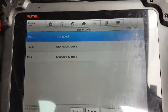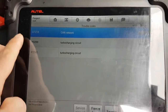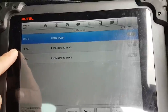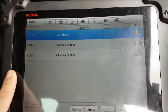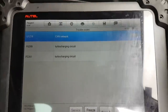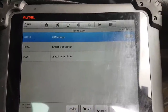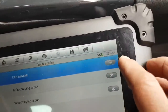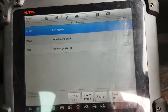After a bit of persistence I managed to log in. At the top: U1218 CAN network fault — not sure what's causing that since the car starts fine every time. The battery is clearly no good — I had to jump-start it the other day. The two main fault codes are: P0299 (underboost) and P2261 — I believe P0299 is underboost and P2261 relates to the diverter valve. Battery voltage is already dropping fast just with the key on.